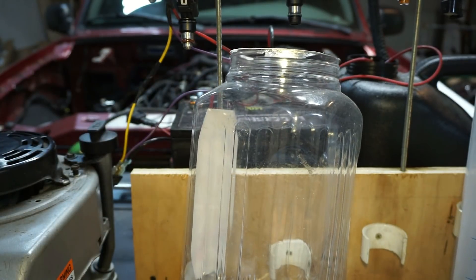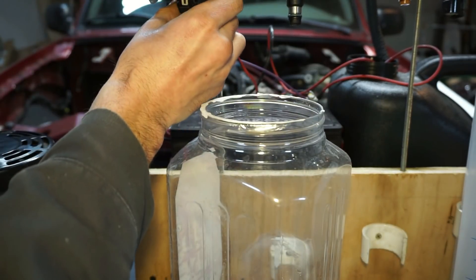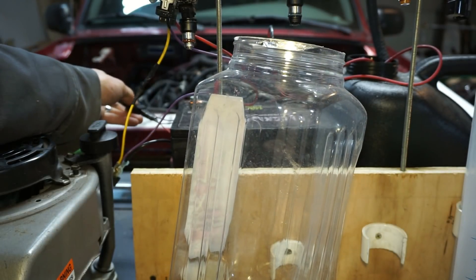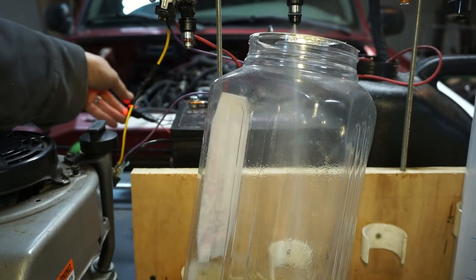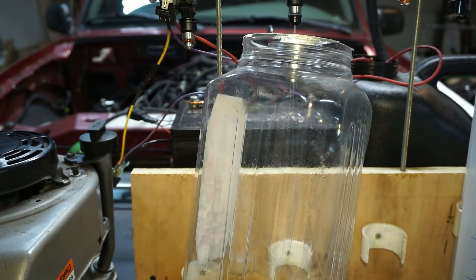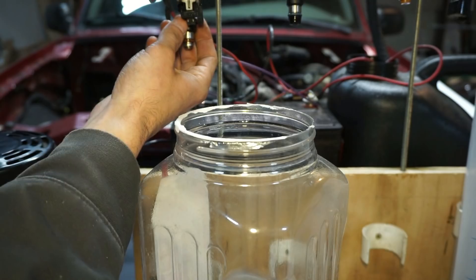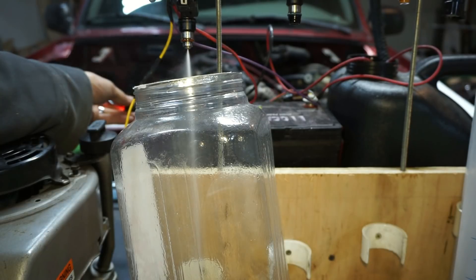Next I want to cover the spray pattern, because there's always a lot of talk about how a decapped injector is just gonna be a solid straight stream like out of a garden hose and you won't be able to properly burn your fuel. So let's look at it. First is the regular truck injector with the cap on it — open the injector up, look at that pattern. Now the decapped one. You saw both patterns with your own eyes — leave a comment, let me know what you think. Decapped versus not decapped — what do you think?